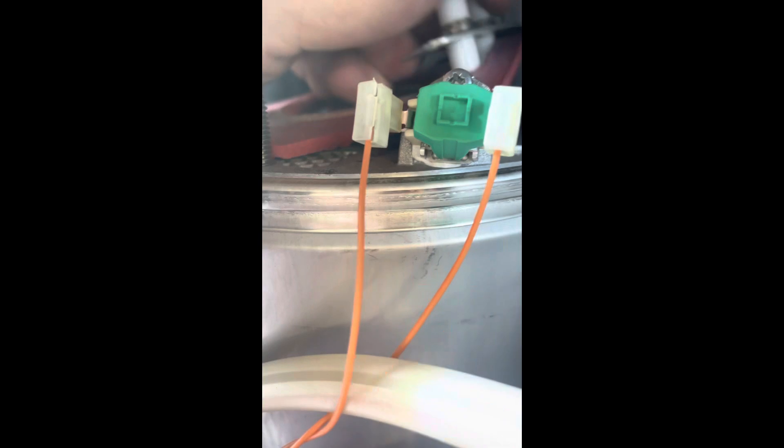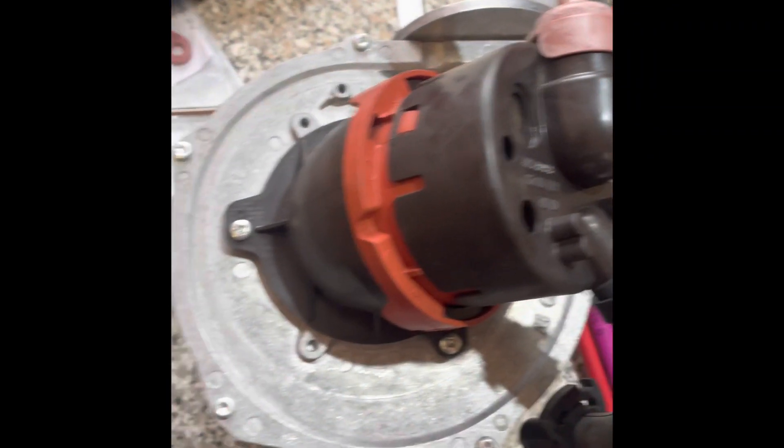While you're here, replace the electrodes as well — if you're going to the extent of stripping it down, you may as well take them out. Get rid of those. Then use a 5mm Allen key to start disconnecting the fan from the manifold — there are two 5mm Allen key bolts and one PZ2 screw. Undo that and remove the air-gas manifold off the back.